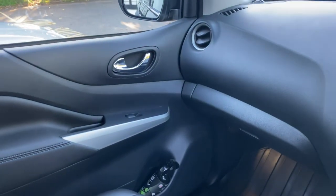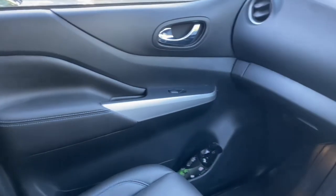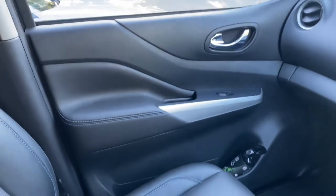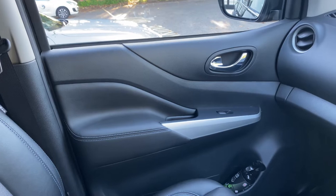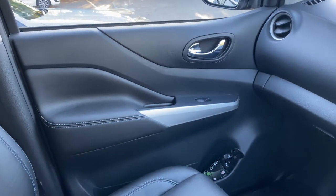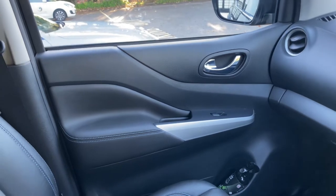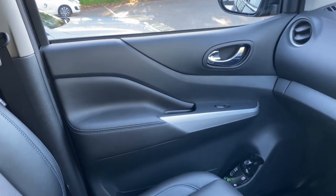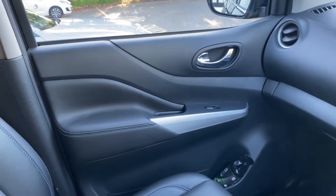As with every one of our installations, we've carried out a huge amount of soundproofing. In these doors it's our four-layer soundproofing system: the outer skin, the back of the regulator panel, the back of the door card, and a sound absorber in between — a lovely egg-boxy soft foam that fills every little gap and cavity, absorbs any resonance, and stops vibration.